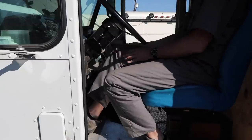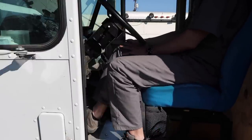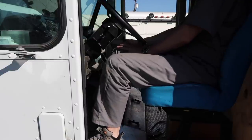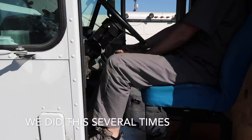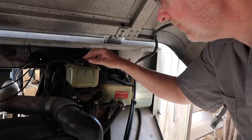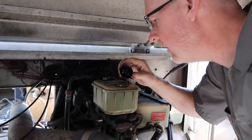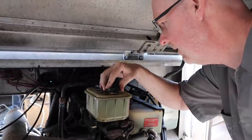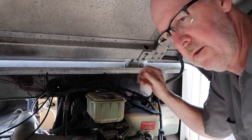All right, pump it. All right, one, two, three, four. Holding. It's going down, going down. That's it. Okay, we're gonna check the reservoir level, see how it's looking. It's down maybe half an inch. That's it, okay. All right, we're good for now. We'll do it a few more times. Want me to check the back one or no, only the... No need to. Okay.